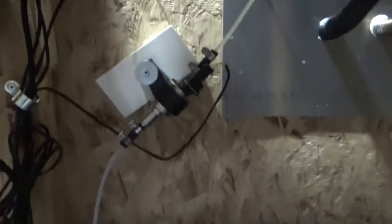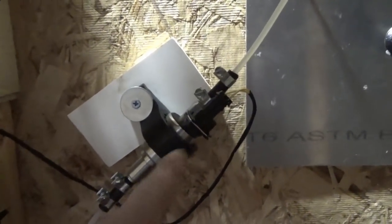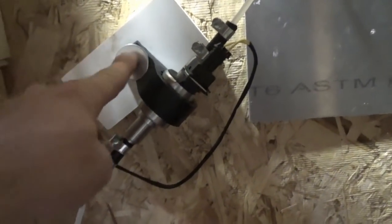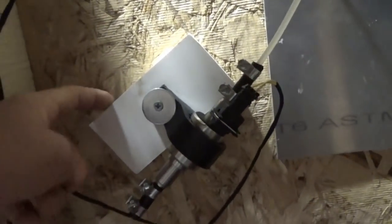This is the pump that I was struggling with. That rubber collar slides over the pump. You keep it at a 30-degree angle, about. That's more like a 45. Alright, I got a fender washer, screw, PVC block going right into the plywood there. But there's sealant and glue, and it's all no leaks.